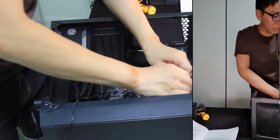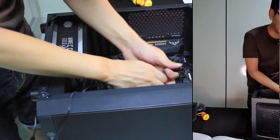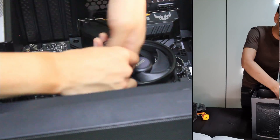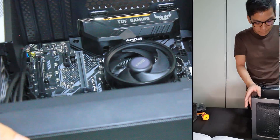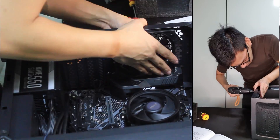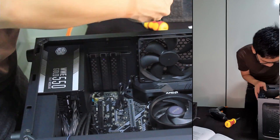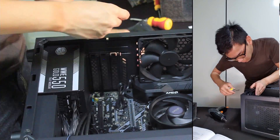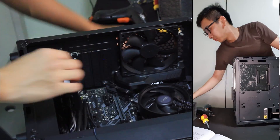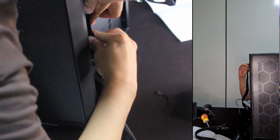After that is done, connect the rest and do some cable management. A good tip: while you are installing, it's a good idea to do a little bit of cable management as you go, not a lot, just a little bit, so that when you are done it's not that messy at the end. After that, connect all the remaining fan headers on the case. Then screw back in the case fan — the rear one which I took out earlier. One important thing: make sure the orientation of the fan is correct. Because this is a rear fan, we want it to exhaust air. As you can see, you can't see the branding of the fan — that's a good tip. If you see the branding of the fan, that means the air is flowing out in the direction you can see the logo. So we are taking air from the front and exhausting it out through the back.